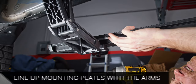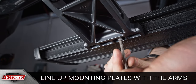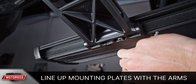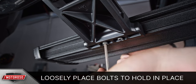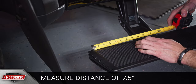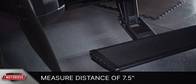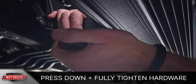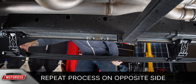On your step, locate the silver sliding mounting plate and line it up with the holes on the motor linkage arms. Gently rest the step inside the channel, and looking from underneath, finish lining up the mounting bolts with the holes, loosely threading one or two turns to hold the steps in place. Before tightening, measure the distance from the edge of the motor linkage to the edge of the step end cap — on the RAM 1500 you want this distance to be 7.5 inches. Then press the step down and firmly tighten the mounting bolts to 10 pound-feet of torque, and repeat on the passenger side.